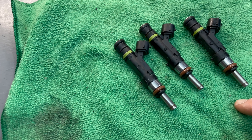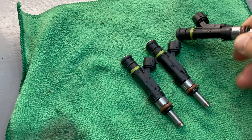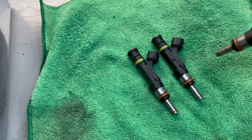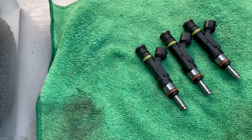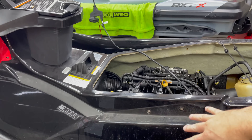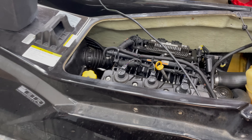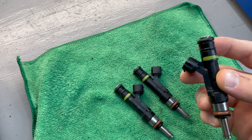Before I put them back in the ski, I just want to point this out. Always make sure you are checking the quality and condition of your injector O-rings. Your fuel system on a Sea-Doo is pressurized, so if any one of these O-rings ever gets pinched, damaged, dry-rotted, or just fails in general, you will send pressurized fuel into your bilge area. And once you have your seat and everything on, this is a high-risk environment and you can risk an explosion — it does happen and you can really get injured. So absolutely make sure when you are doing your maintenance, you are checking your injector O-rings.